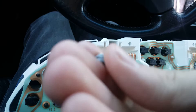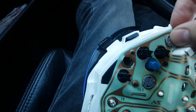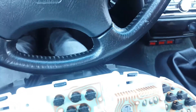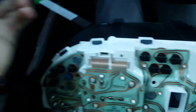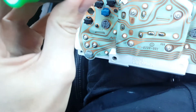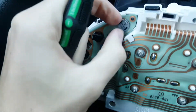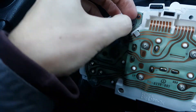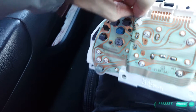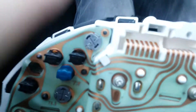I'm just going to use this spare spot to show you how to put it in. You just get your LED like this - link in the description. This one's a five millimeter blue. Just kind of put it in the hole. That's where the little screwdriver comes in handy - you can just kind of put it in there and twist, kind of push it in. Just twist it in a way that it locks into place. Your light's installed.